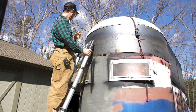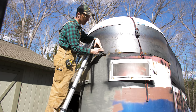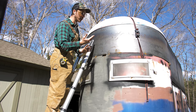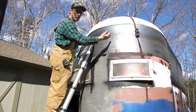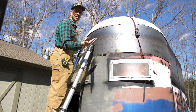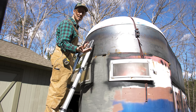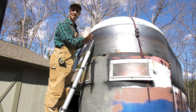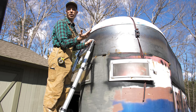Curving. It is pretty much flat and straight with the rest of the trailer up until halfway, and for whatever reason it starts to get a little gim-gaggered past the halfway point. Plus, the curvature portion of this trailer is more than 8 feet, and 8 feet is the length of all my steel. So by cutting it, we can then put a long piece that will match up all the way to the end, and I'm not gonna be scabbing on another small piece, which is ideal. So that's what we're gonna do.